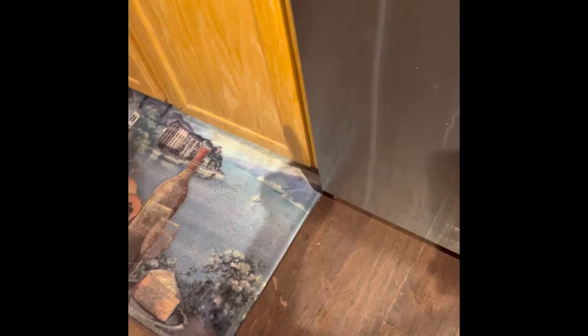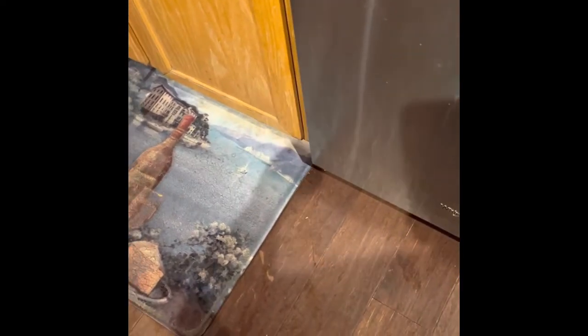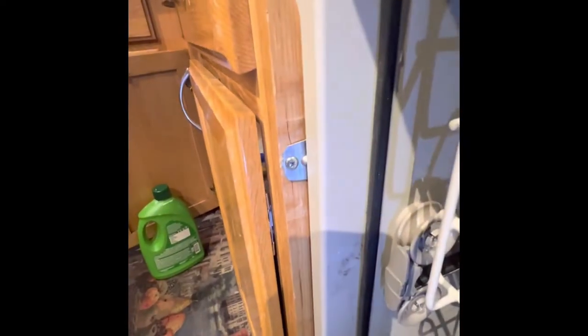If you want to hook it up, it's probably going to be under your sink. That's where you're going to unplug and plug it in. Take out those screws — this will allow you to pull the washer out. Just like that. Take them all the way out.